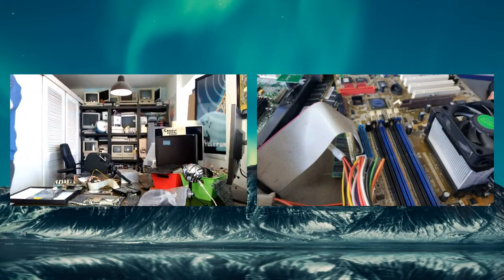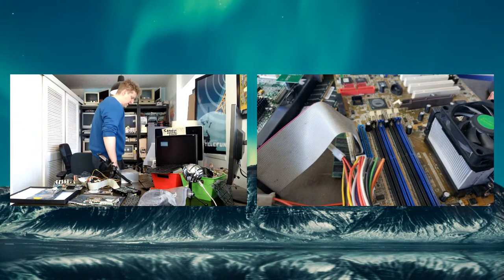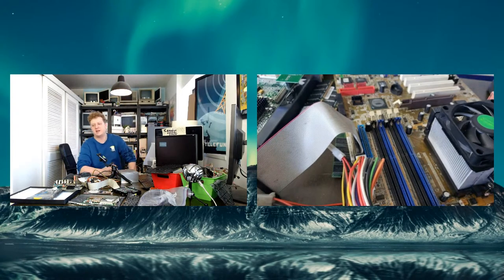Very exciting. Right now, we are struggling because none of the video cards showed any video. And I don't think it's their fault, necessarily, but there might be a CPU issue. I'm trying to locate a speaker in a case to hook up to this board so that we can have error beeps to discover if it is a CPU problem. So, I'm on the hunt right now, and I apologize in advance that this might not be as exciting as you'd hoped. I just have to track down a speaker.